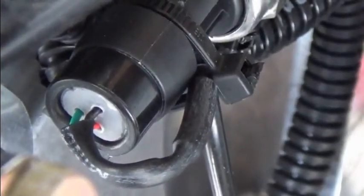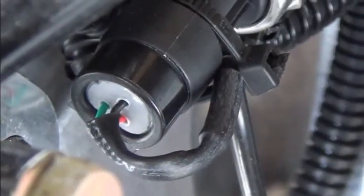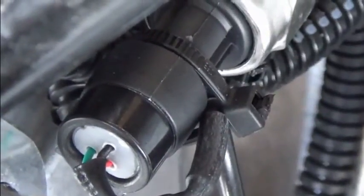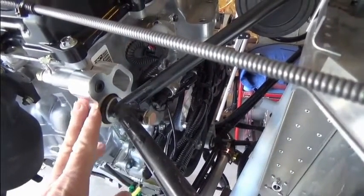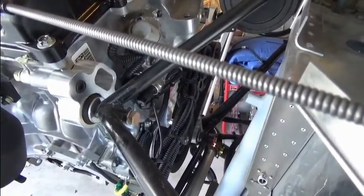Here is the sender installed for oil pressure. I have used a small black wire tie to relieve any stress on the leads that are plugged into the sender itself, doubled the center lead back on top of the plug and tied it to itself. The oil pressure sender is at the back of the engine on the pilot side, just below the upper motor mount on the pilot side. It was a little difficult to find just in the drawing itself, but you should be able to easily locate where this sender gets installed.